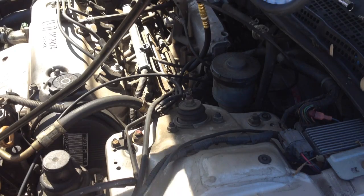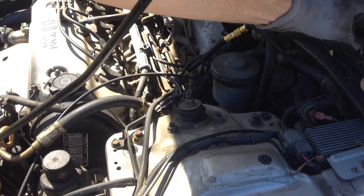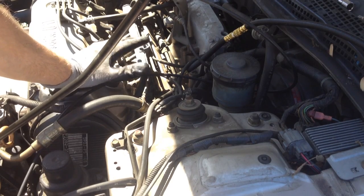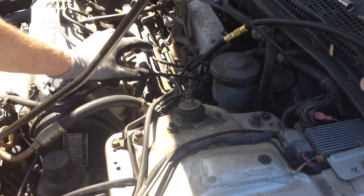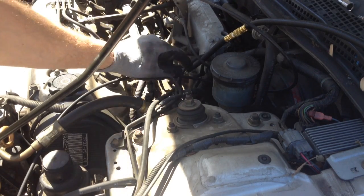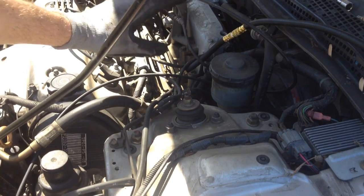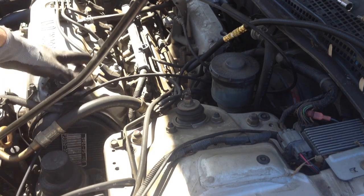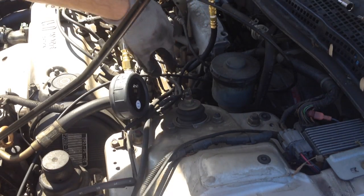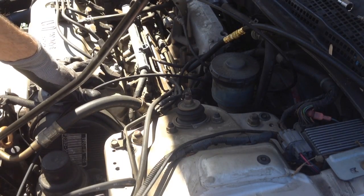If yours is equipped with a washer, remove that as well. Then use this US General kit — I'll show the attachments in the description — and go ahead and thread that fitting into the port. Please make sure you do not strip it, otherwise you're going to have to replace this little pipe assembly right here. Make sure it goes in straight. I even removed a wire harness bracket here alongside the intake manifold — it has a 10-millimeter bolt — just to get straight access. Also, on all the connections in this kit, use Teflon tape to make sure there are no leaks.